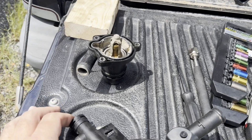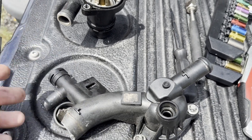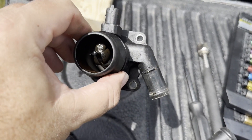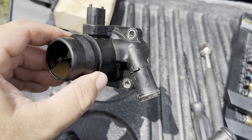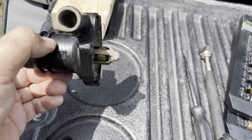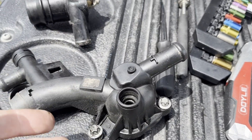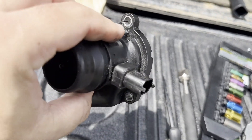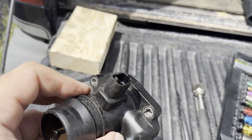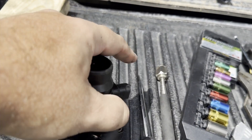Here I'm showing the parts I took off again — you can see that plastic just turned to total garbage. Both new parts are aluminum, cast. Here's the old thermostat — nothing was really wrong with it, but it would run a little hot. I'm hoping this new one, once everything is calibrated in with coolant, will run cooler here in Florida. The bolts were captured on the old one, but on the new one they're not — something to watch out for. The original is about 10 years old, 145,000 miles, and those bolts are not captured. I lost all three but was fortunate with a flashlight and magnet on a stick to get them back.